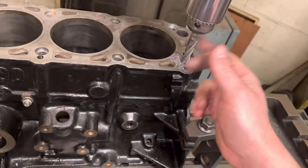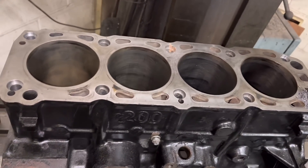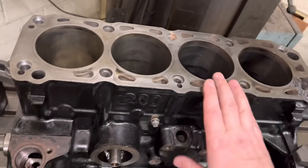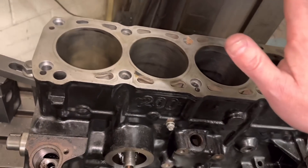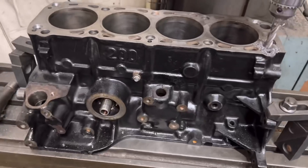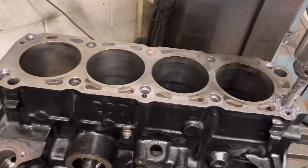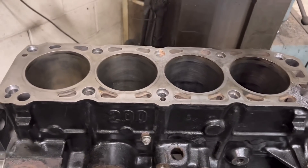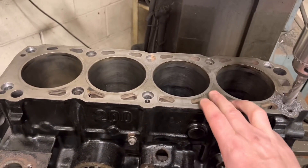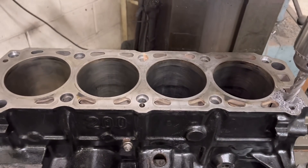That is a very important process on these end four. We've got another block for Dave to do which has got none of the six in the middle, so I've got to do all 10 long-stud conversions. And then once the last BMW is finished on the boring bar we've got to put Ductile Iron top hat liners in both these blocks — so plenty of work from Dave. And of course Dave being Dave, he's pushing me on nicely and wants to try and get it back for the weekend. Thanks Dave!